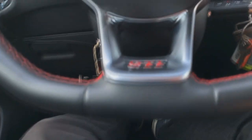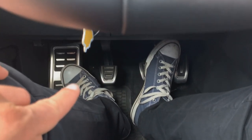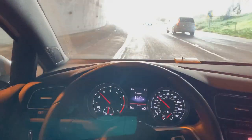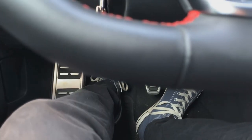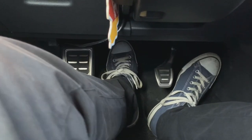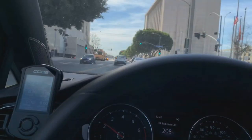So it made a huge difference. Use two bushings — simple and easy to install, cost me about $10. Worlds of a difference. The vehicle just picks up a little bit better now, especially taking off from red lights, stop signs, first gear — you can definitely get going a lot quicker. As you can see here, let's go ahead and test it out: releasing the clutch, a little bit of gas — and there it is. So again, it just eliminates a lot of that dead travel.